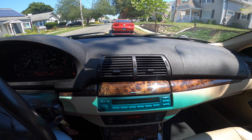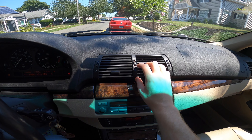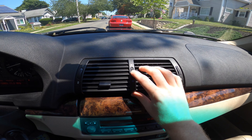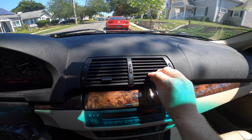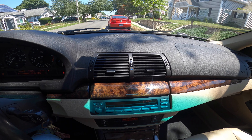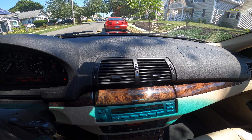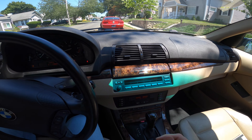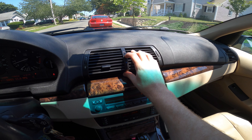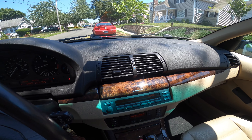That was the case with my wife's car that we're in now. Fortunately, all I had to do was come out to the car, check this, and make sure I scrolled it all the way down to the blue. That made a huge difference, maybe 10 or 20 degrees in how cold the air is. So if you're having AC problems in your BMW, before you go take it to the shop or diagnose anything, the first thing you should do is just take it to your driveway and make sure that you scroll this all the way into the blue position.